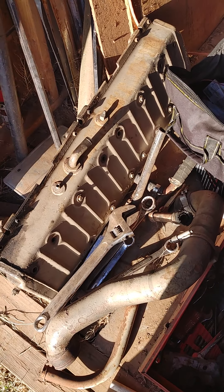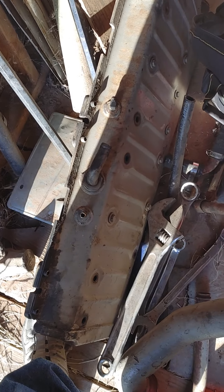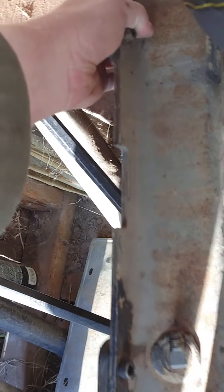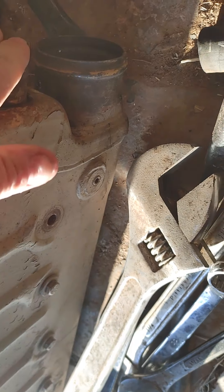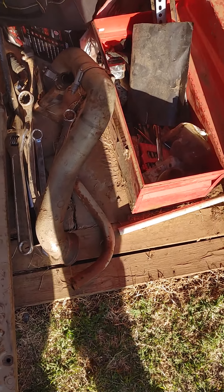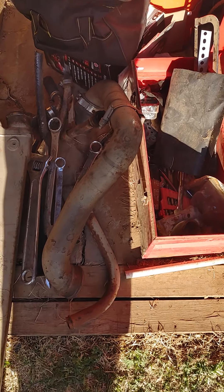You can see the difference — here's the old after-cooler. It's a wedge shape at the bottom, a lot heavier than the other one. It's got three water inlets and then the turbo inlet. All this old stuff will be for sale if anybody's wanting to repair their low flow. This is the tube for the turbo to the after-cooler. There are some pieces that you'll have to have — this comes off the thermostat housing.